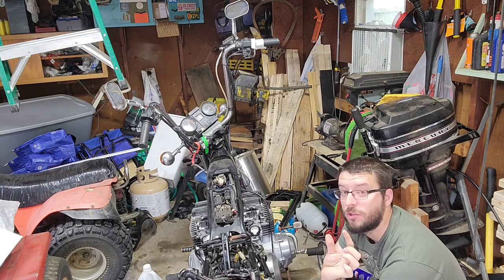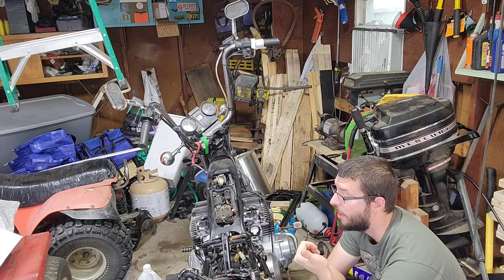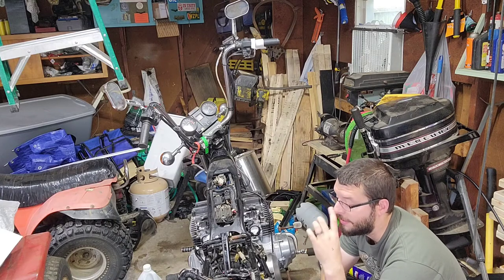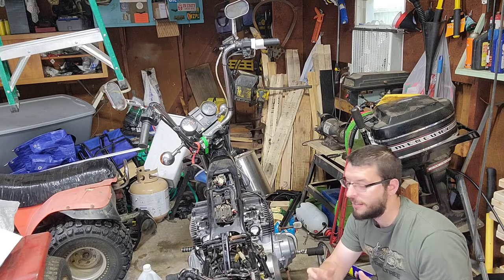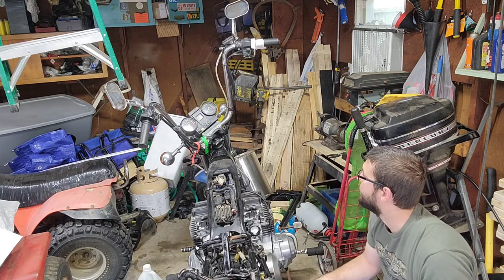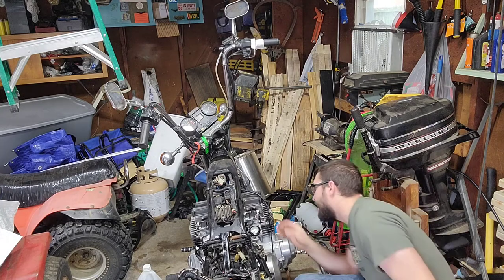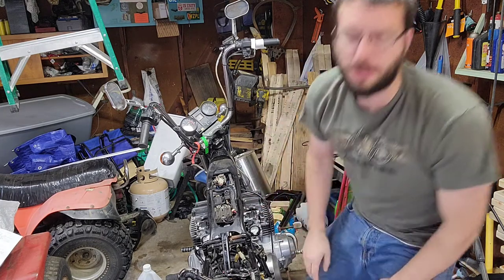Made throttle cable adjusters. And made it to where one cable adjuster could work because I needed a short one and needed a long one, and I had an Allen cap bolt that was absolutely perfect for the job. Cut a slot in it, nuts and whatnot, and it is safe. It is actually stronger than what you could buy, but I couldn't even find any on eBay or Amazon, no matter what I typed in. So I got all that adjusted. Everybody's happy on that. I'll show you here the whole assembly.